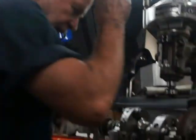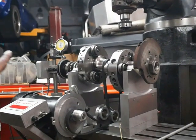That is the reason why, again, you're dealing with natural wobbles and invisible forces. That's the reason why I balance with clay, adding clay to the opposite side of the heavy spot. I do that on the heavy side first, that way I know that if that heavy side is balanced and I come back and balance the light side, that side can't change on me regardless of what I end up doing. And it will change the minute I take it off and put it back on. The numbers will go out the window. But if I begin to bring the heavy side back in, they'll start coming right back down to what they were originally. Again, it comes down to eliminating as many factors as you can.